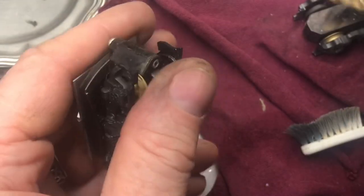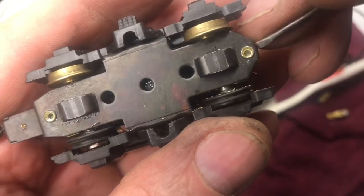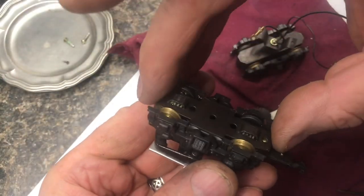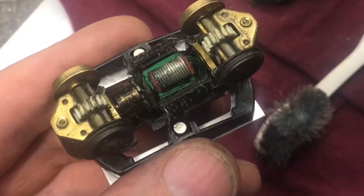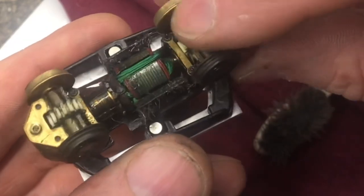These are not serviceable unless you drill the rivets out. The rivets are very soft and made out of brass. With the rivets drilled, we can pull the bottom of the truck off. Everything's filthy in there — lots of steel wool, everything dirty. Now it's just a matter of scrubbing everything out.